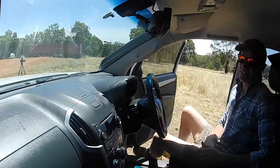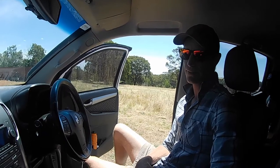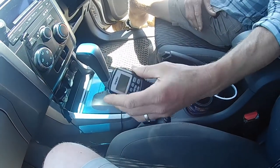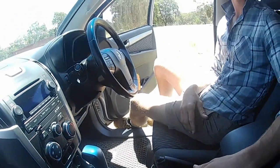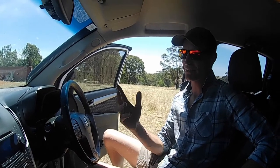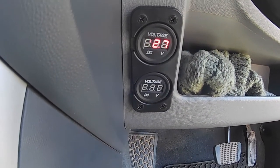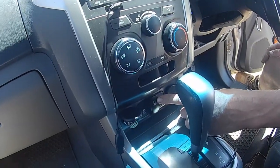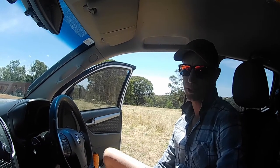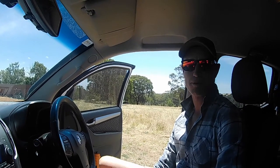The first thing, under the bonnet, is a small yellow top battery, which is 45 amp hours. That powers a few different things in here — it's wired up to the Uniden UHF so it can run unassisted from the vehicle. I've got a few meters to tell me what amps and volts are being drawn. I've got a spare auxiliary tank for the diesel, 35 litres, custom into the back of the tray, so I can just hit the switch and it siphons into the main tank.